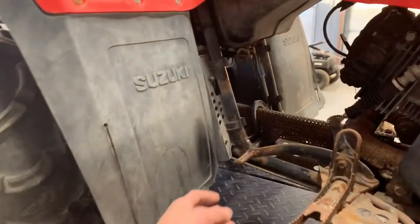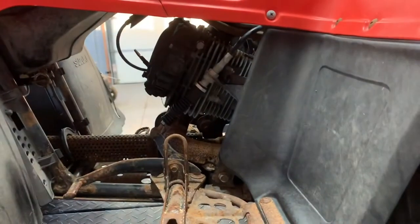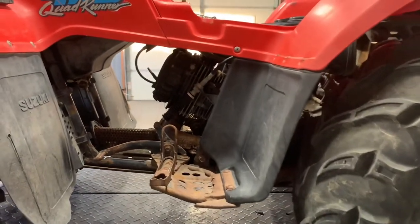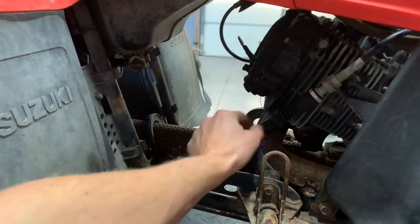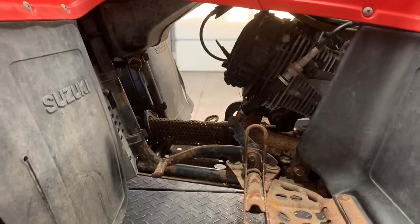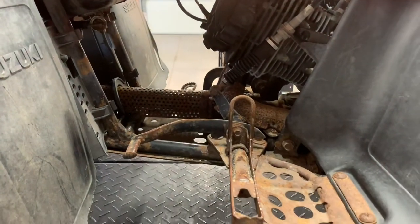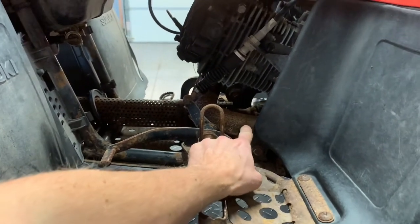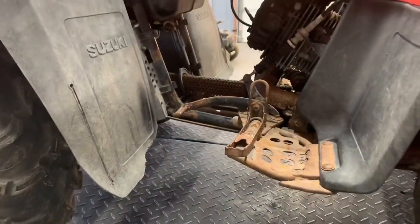On the left-hand side you've got your gear shifter — it's a five-speed. Five gears up, and to shift down you push down. The cable here goes all the way back to your transmission in a rainbow shape. Make sure that cable is in good condition with no kinks and this boot isn't ripped or torn. This is your exhaust header, so you will notice your left-hand foot gets unusually warm, though the plastic cover means it won't burn through your shoes.